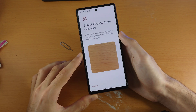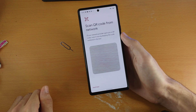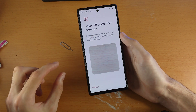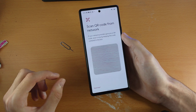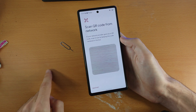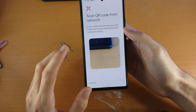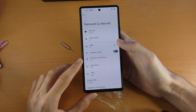It will say 'Download your SIM' — tap Next and it will ask you to scan a QR code from the network. To get this QR code, go to your carrier's store in person — for example AT&T in the US or EE in the UK. Bring your physical SIM card and ask them to convert it to an eSIM. They'll give you a piece of paper with a QR code and a bunch of numbers. Place the QR code in the camera frame and your eSIM will be added, giving you two SIM cards in your Google Pixel 6.